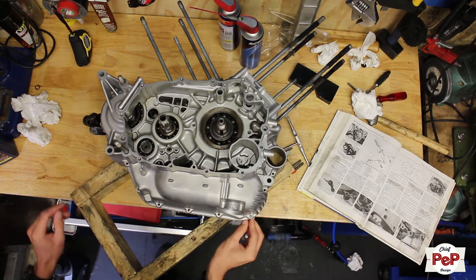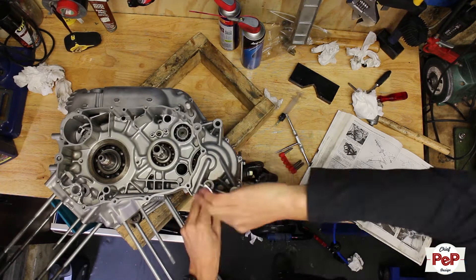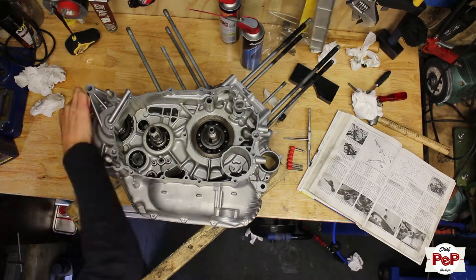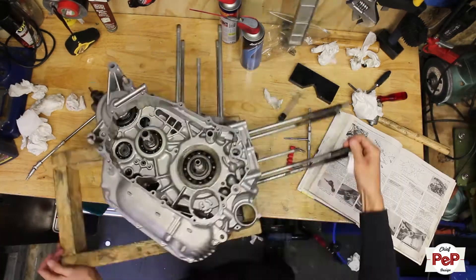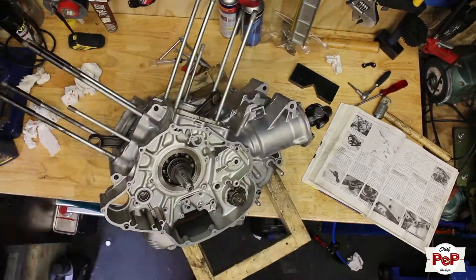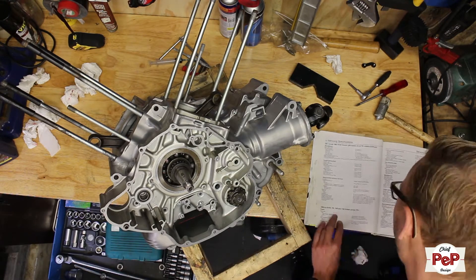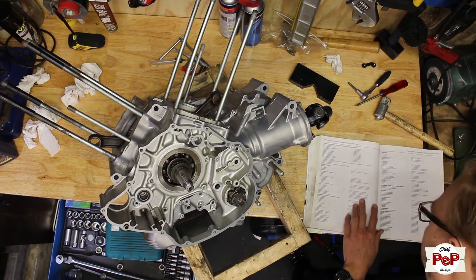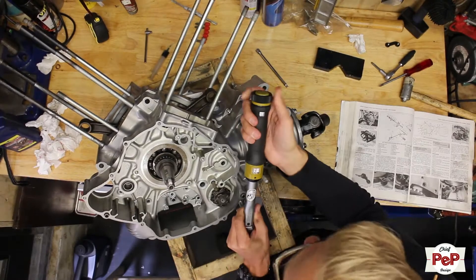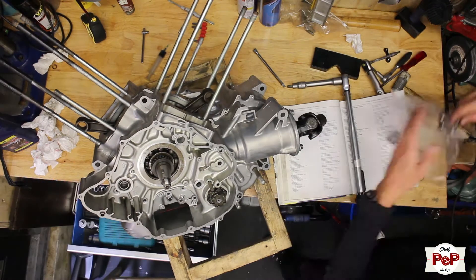To close the engine permanently there is a specific tightening sequence — make sure you use this sequence. Due to the tightening, the liquid gasket fluid came a little bit out of the engine and since it was still liquid I could easily remove it with a piece of paper. The engine was on the wrong side to start the tightening sequence correctly, so I first put bolts everywhere I could and then turned the engine over to start the sequence in the right way.